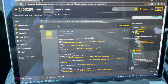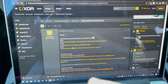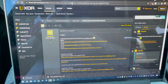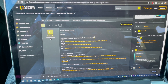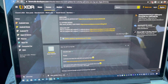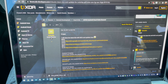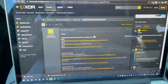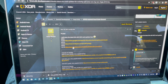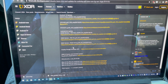Now that we're over here at the computer, I'll be showing you where to get the latest MCU updates as well as the latest Android updates for your head unit. I'll also be providing the download link below where you can get to this development forum, which will contain the latest updates and was last updated August 23rd of 2021. My head unit is running MTCE, and the latest version I can get is 3.78. So what I would do is click this download link and download my MCU update, which is going to show as a .image file.